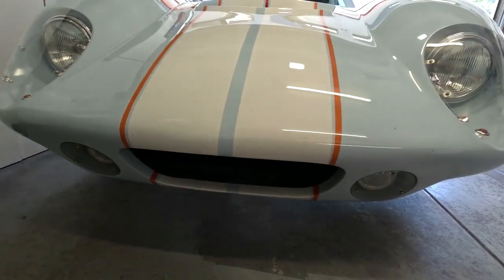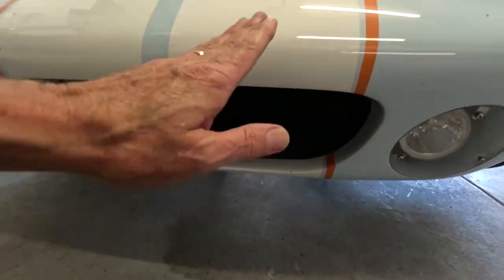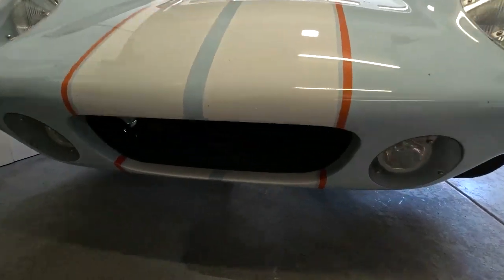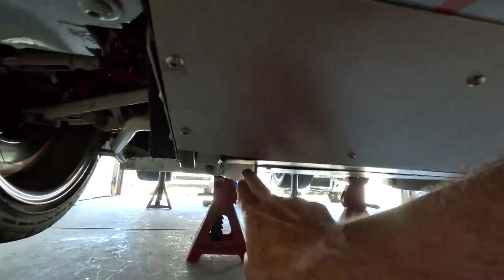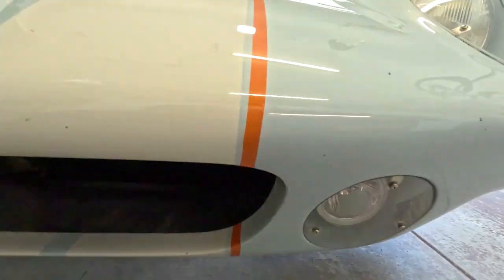We modeled the front of the car and the biggest issue is air coming in, hitting the radiator, and being driven under the car — that showed to be very bad. The scoop I put on using conveyor belt material angled forward did excellent for downforce, but at the expense of a huge drag penalty and a lot of turbulence off the sides.